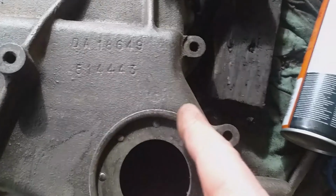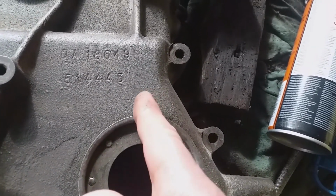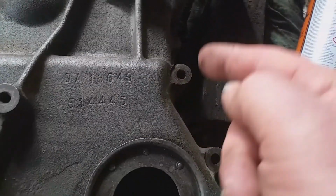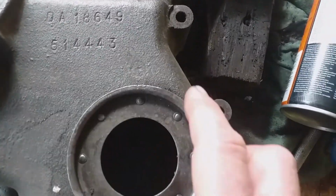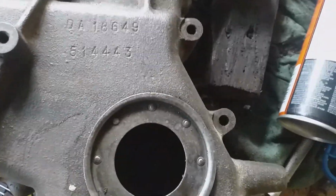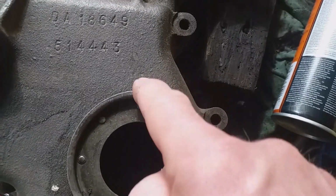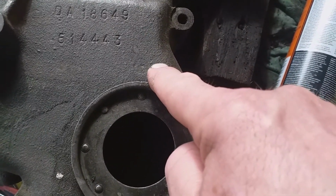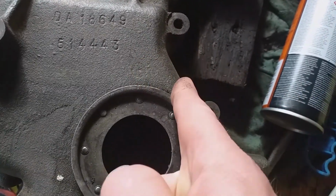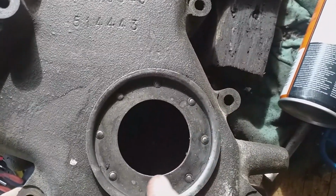Now as I'm going to use 90 octane fuel in this, I want to be 6 degrees back of top dead centre, which I'll mark. It's marked on the flywheel, 3 degrees, 6 degrees, top dead centre, vice, you know, and other things. So these marks, whilst they're not even mentioned in the workshop manual, the timing cover marks, but they are there. That's definitely a factory mark for top dead centre. Although I'll be using the flywheel with the 6 degrees back of top dead centre because of the fuel we're using.